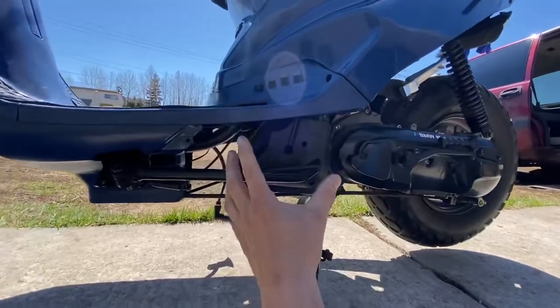Now the airbox has to go on. If you do any kind of testing with the airbox off it's going to mess everything up because it's going to be getting way more air with the airbox off — so now it'll run lean again because it's not getting enough fuel probably. We need to put the airbox on, take it for a drive, and see how it runs. If we can't tune it to run well, then it's running too rich, because 10 percent is quite a bit.